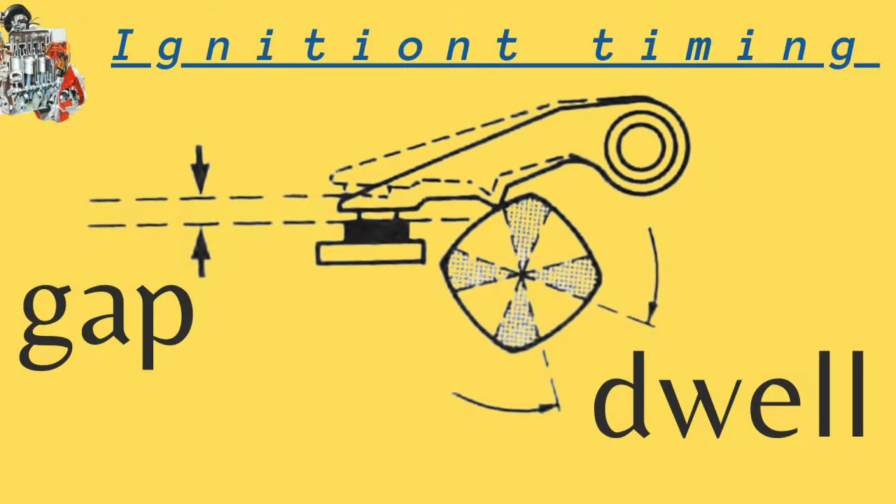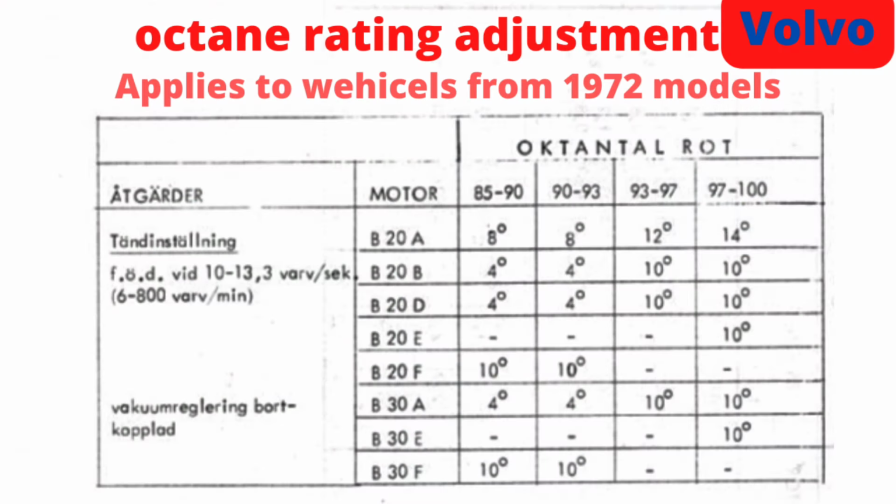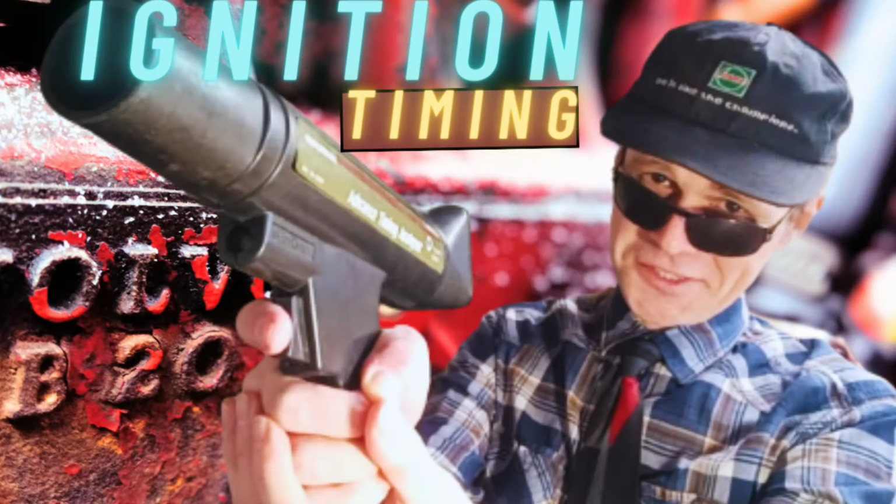Oil, timing belt, and of course spark plugs. And you want to accomplish all the maintenance which is required for an average gasoline engine. Ignition, yes, proper ignition is really important, this angle of ignition, dwell, because octane ratio can be different, but this is critical just for mechanical ignition, the oldest models, I mean.